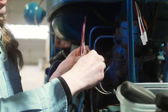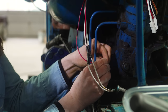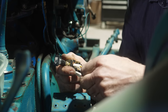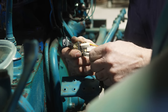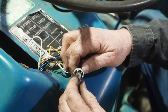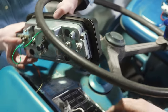Connect your neutral safety switch here — we have a separate video on the safety switch in the ignition tune-up video. Those connect just like that, and then your tail light wire in the back just plugs in. We got the switch out of the dash. On your new headlight switch you have the heavy red wire in the back — that's the power coming in. The two wires are for your rear lights and your instrument gauges, and they go on the prong up here. Your headlights go on the prong on the other side. Make sure that rubber gasket is around the perimeter before you start hooking up wires.